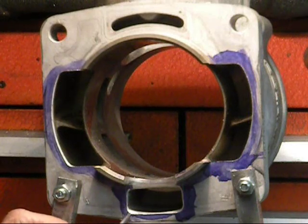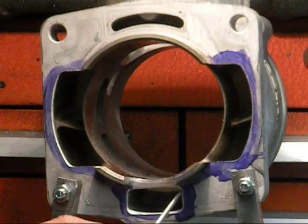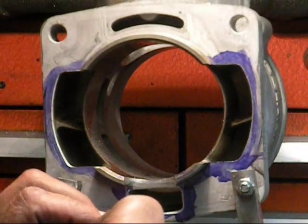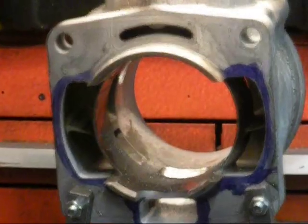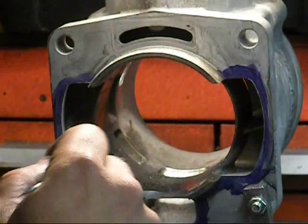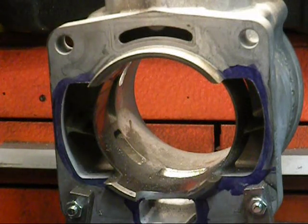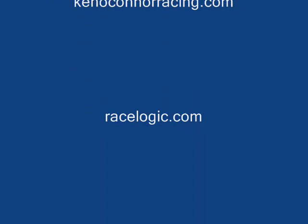I did the match port to the gasket, and it's a really steep angle in here that we'll blend in. As you can see, there's a lot of room for improvement on the transfers as well. We're going to do this to the cases as well, and I'm going to take this and blend it in about 10 millimeters, just like we did on the exhaust port. The blend on the port match is complete — got everything nice and tight. This port right here had some pretty serious casting flaws in it. I went in with the three inch bit all the way to the top and removed all the slag that was in there.